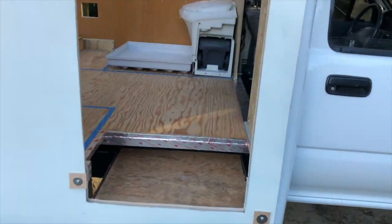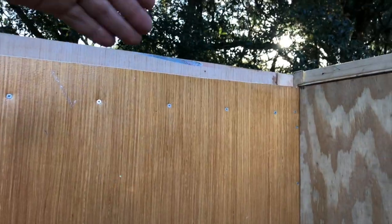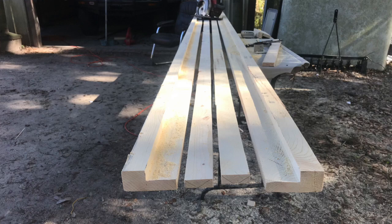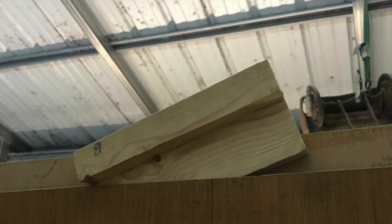Side. The way my dad designed the walls here, we gained about 2 inches of interior headroom the way we have it done, and the wall basically is notched and fits down into it. You can kind of see what's going on there. So the ceiling and roof will be built and fall down into place once we have that all done.